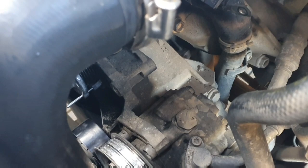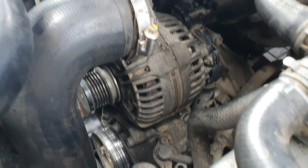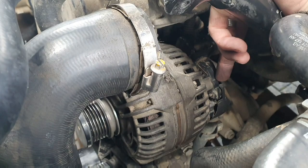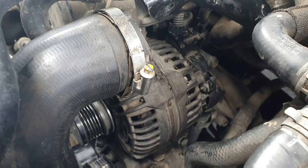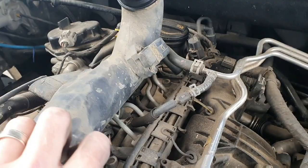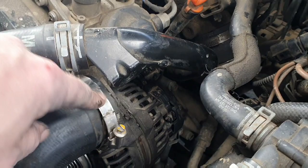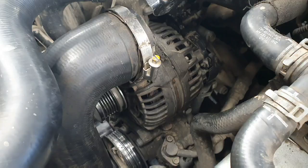The alternator is back in place. I've plugged back the little plug at the back, and the power lead goes on with a little nut tightened with a number 13 spanner. I'll reinstall this little pipe — it's got two hose clamps and two bolts which you use a T30 Torx for. Once that's done I'll plug in the sensor, do the belt routing, connect the battery, and then we're done.